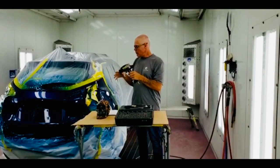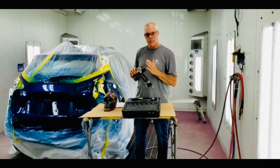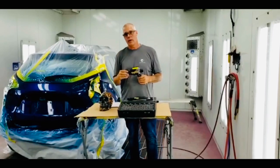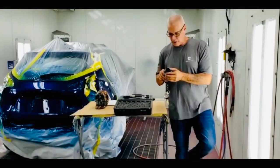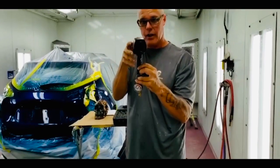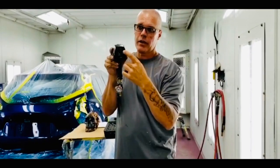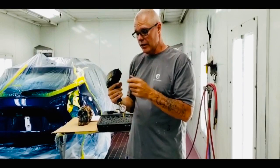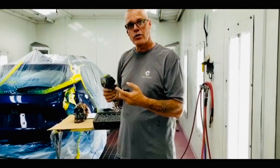As you blow it across the panel, you'll be waving it back and forth — just like if you're going to spray clear, base, or sealer. I recommend doing this right before you get set to spray: clean the car, tack it, blow it with this, and then go to paint — each step through each different substrate you're going to put onto the vehicle. The safety clips go on when you change the pin. To change the pin: push the two clips in and pull out the snout. Inside is the emitter pin — use needle nose pliers, grab it up towards the top, and pull it down. Put it back the same way, being careful not to bend the pin. Set the regulator at 50 PSI — don't go higher. The gun has its maximum strength at that. If you go lower, it slows down some of the deionizing air; if you go higher, it's not as efficient.